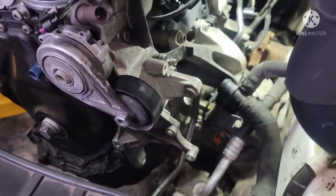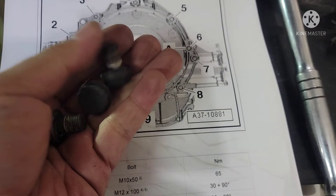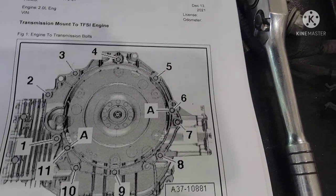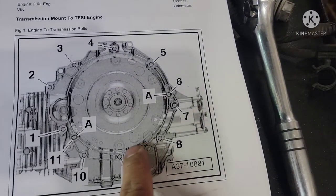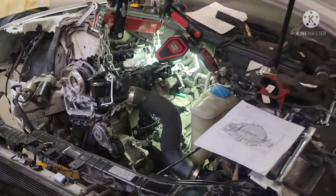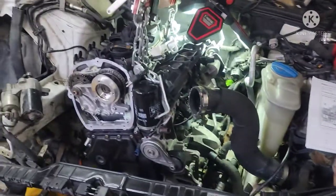There are four at the bottom down there, and that should be secured. Now I've got three flywheel bolts — make sure you put blue sealant on those. Those are the flywheel bolts to the torque converter; there are only three, and you'll access them through the hole right here. That's it guys, thanks for watching — this is the Audi A4 2-liter, signing out. See you again.